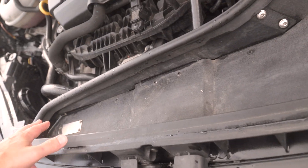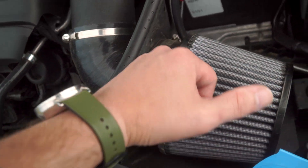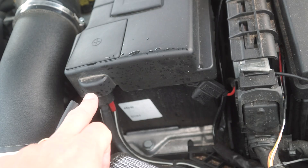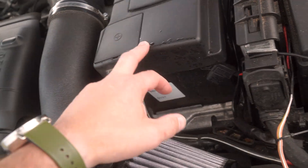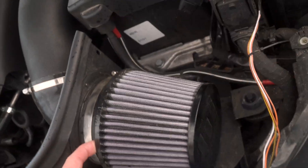One of the top questions I get on my intake installation video is does it have issues with rain. What I'm seeing is obviously lots of raindrops coming in on the seal here. There are some right around the air filter and even some here on the battery cover, which leads me to believe water was coming in fast enough to get sprayed up and over the air intake. I'm going to take this off and see if there's any moisture on the inside.